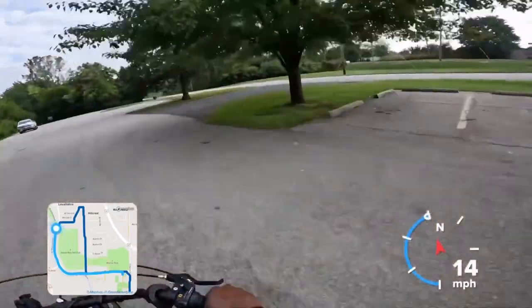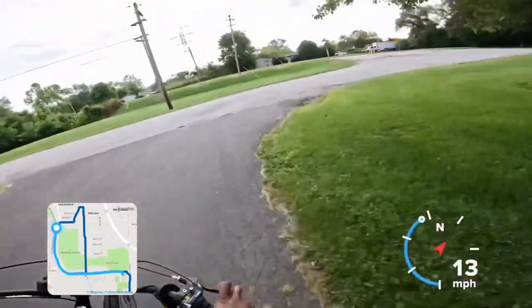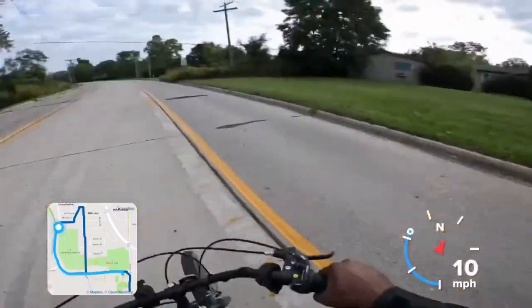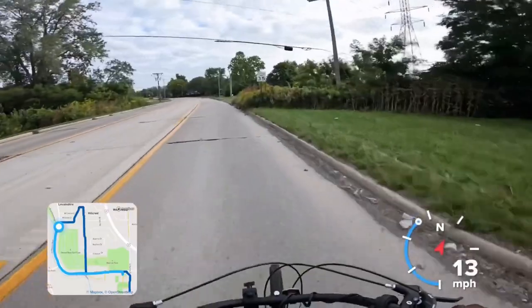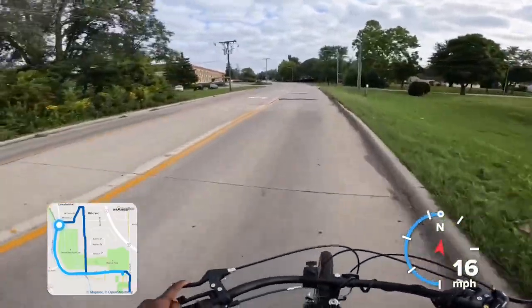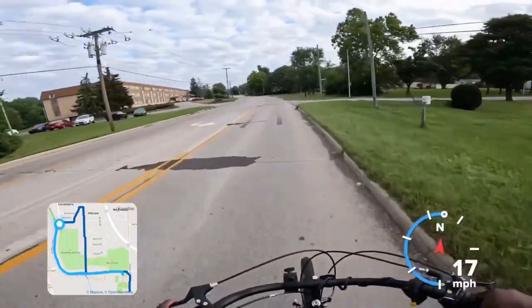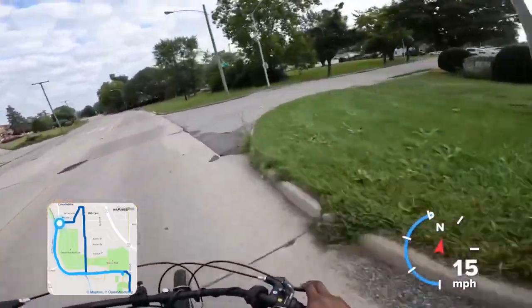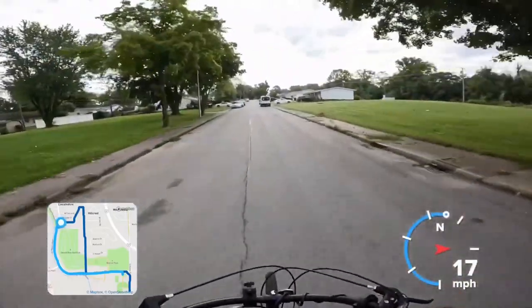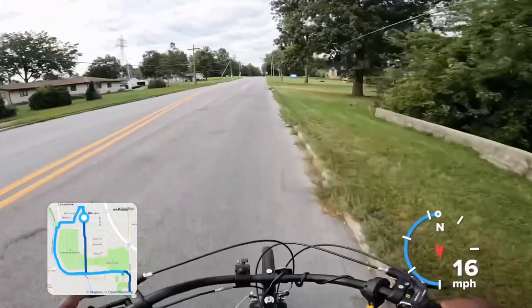The wheel set that's included with the Lachlan, as far as I can tell, is fine, but if you ever do have to replace them, try and get steel rims. I have seen builders successfully adapt rotors to these bikes, but it's a bit advanced for new builders. At the end of the day, the rim brakes are just a lot easier to deal with if you're brand new. And some of the adapters they sell for the rotor kits are outright dangerous, so be careful if you try and adapt them.